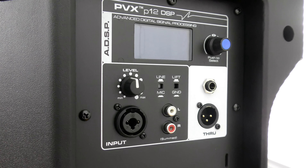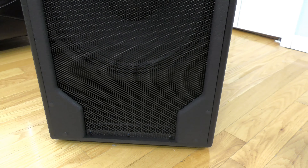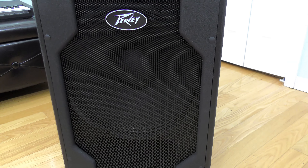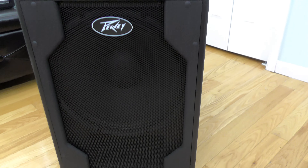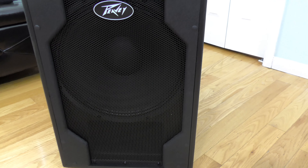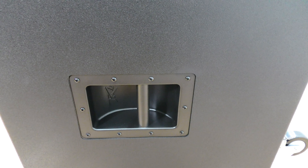Next up, the PV XP subwoofer. This comes in a 15-inch woofer configuration with a really large bass port for airflow at the front bottom, so you can put this against the wall without worrying about air not being able to exit. It does push a lot of air, but it's not very booming or very deep bass — which is one of my minor gripes. I wish the bass had been more rattling and heavy all around, but that's probably due to the price point and the wattage, which is only 800 watts peak, translating to about 325 to 350 watts RMS output.